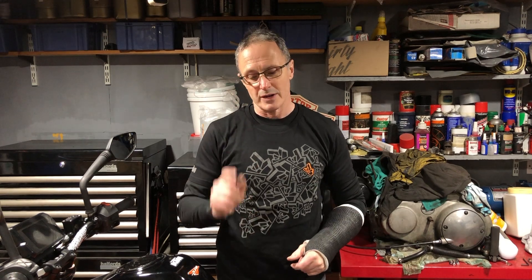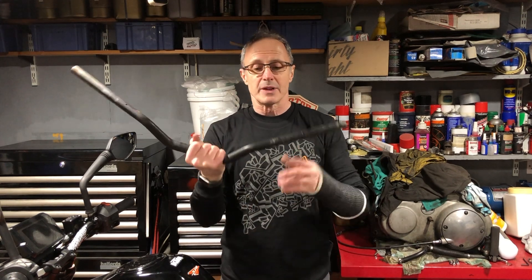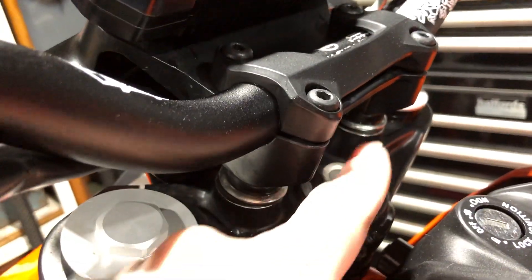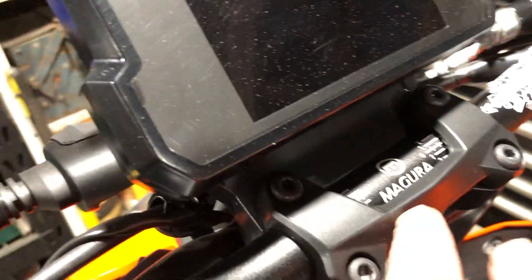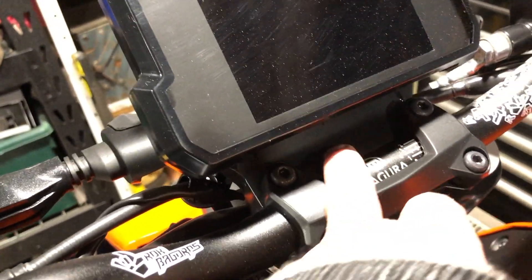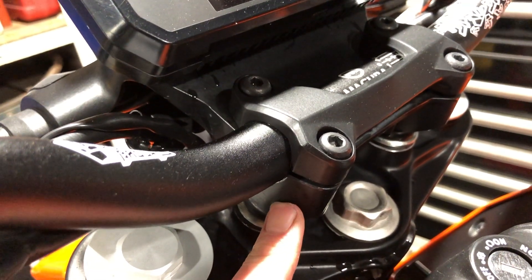But even when riding them I can still feel that the handlebars are slightly twisted, and that is nearly always down to the handlebar risers. If you smack the bike hard enough to bend the handlebar, then the thing it's attached to — the handlebar risers — also takes a similar impact. These are one piece, connected across here because it's also the mount for the TFT screen. So I think we're going to have to replace this clamp.